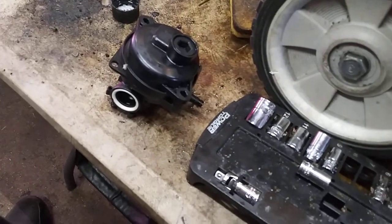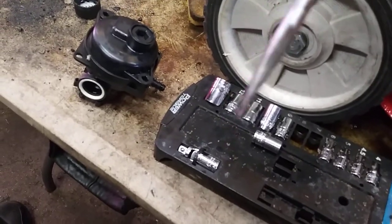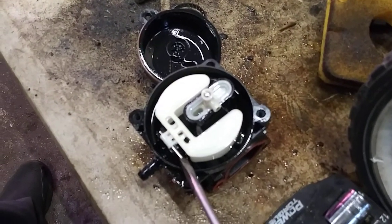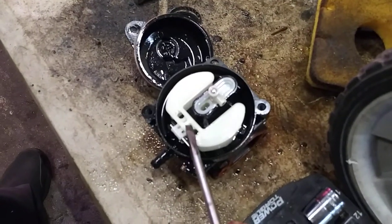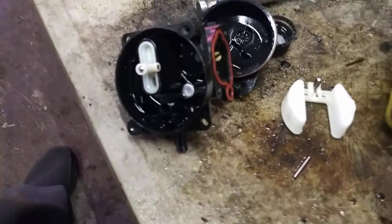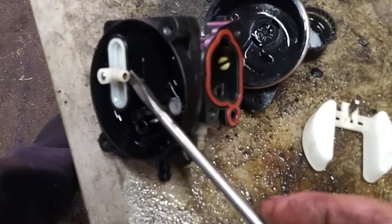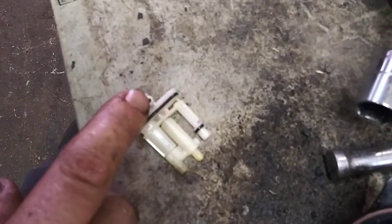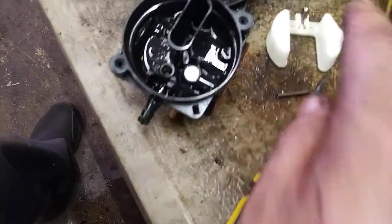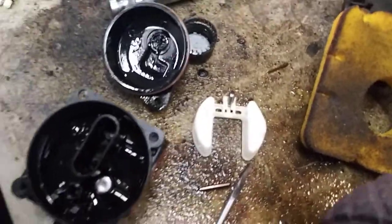These are the easiest carburetors I've ever found to clean out, but if you do need a new carburetor, it'll be in the description below along with air filters, fuel lines, and anything else you need for this job. Now take the flat head and put it underneath this bar, give it a twist, and pop the whole float right out. Be careful not to drop the needle valve — it'll slide right out of the pin and you're going to need all that. Take the flat screwdriver and stick it between the white piece and the black piece and give it a twist to pop that out. This is the main jet — what needs to be cleaned. It needs to spray clear through all these passages here and here. Spray through everything, make sure the needle valve is nice and clean, and check that the rubber tip is not swollen or cracked. Rinse out your bowl.